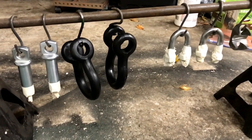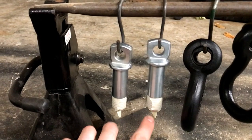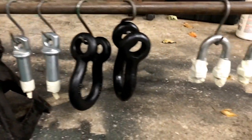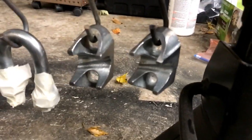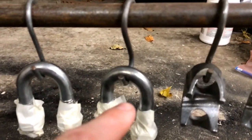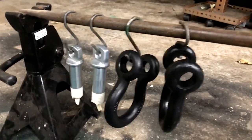What you're actually looking at here — these are the shackles right here, and then these are the pins. I actually have the threads down here; that's what the tape is on. I'm gonna paint these red and then mount them to the front of my bumper. I have these brackets — I'm trying not to touch them because I cleaned them with vinegar; I don't want my oily skin on there. These will be flush on the front of the bumper and then these U-bolts will actually go over the shackle bolt and hold the shackle on. Later in the video you'll see how it works out.